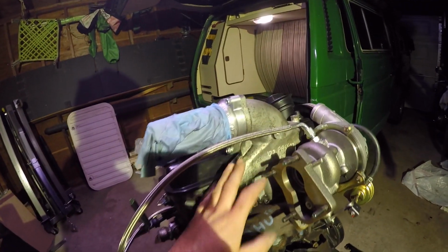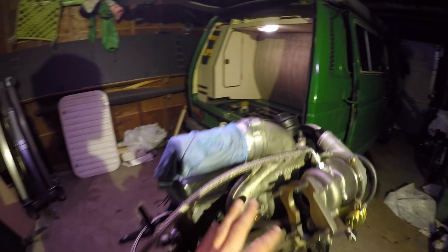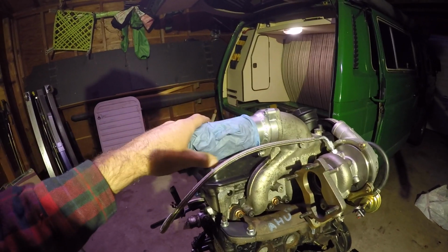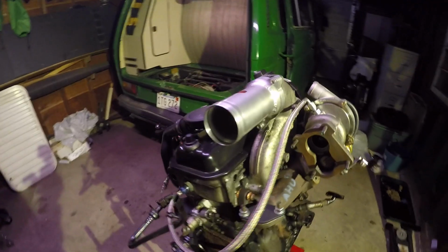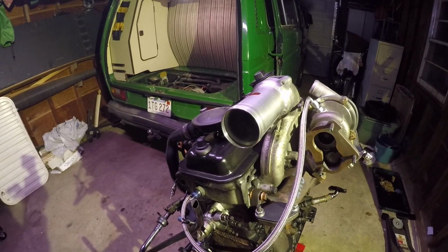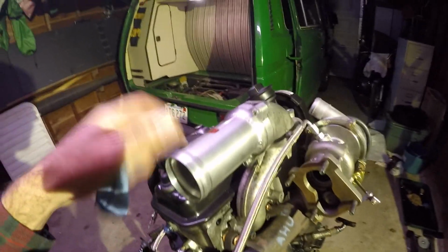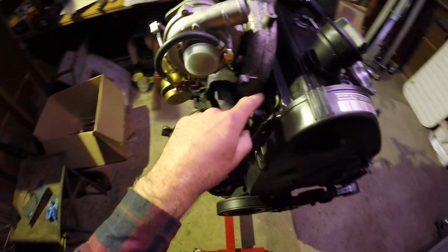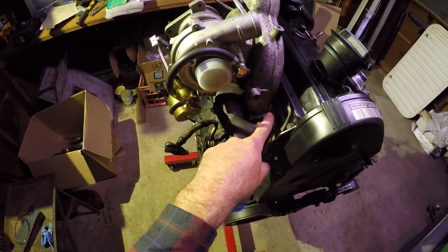And I got the PD 130 intake manifold with the Allard EGR delete intake. Pretty slick setup, great quality. This thing came with a bunch of carbon, which was typical, and one thing to note too was the intake ports had a ton of carbon.